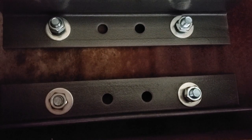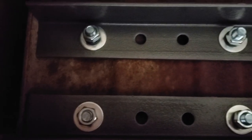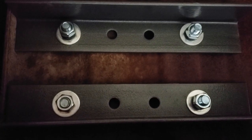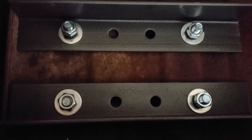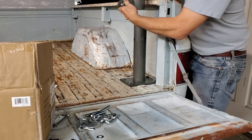All right, here we are under the truck, and you can see that's just mocked up into position. If you notice, when I pan across, it's not attached to anything other than the bed. That won't do. So this is the one negative with this particular crane, is that you're not attached to what they tell you to attach to, which is attached to the frame. But this will allow us to mock up, assemble the crane, then we can figure out a proper bracket system for it. Now we've at least got the crane in place.